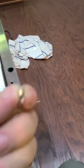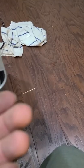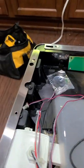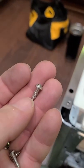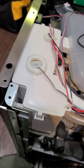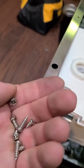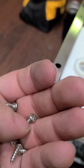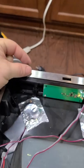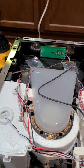Now, removing the outer cover is really easy, but pay attention to this. The back right corner is a really short screw with a washer. Then all the screws that go into plastic — these four are long screws with the smaller head. This back screw that goes into metal is a shorter but fat-headed screw. The two in the front are really small screws similar to the one with the washer, but without the washer, and they go up here and here. Make sure you're paying attention to that or you could potentially damage something.